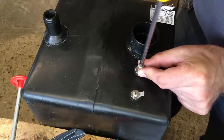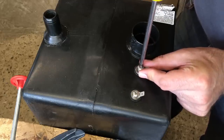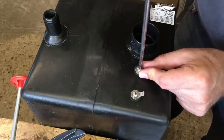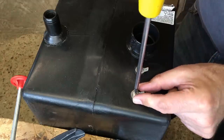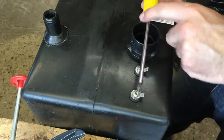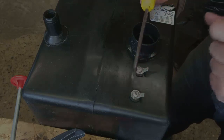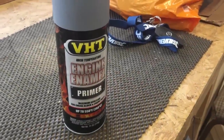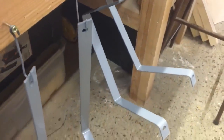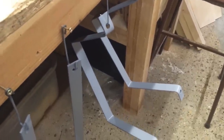On the level gauge we've got a couple of cables that will run down underneath the vehicle and join onto these with a couple of spade connectors, giving us a signal when the waste tank's full, which will come up on the little control panel inside the van. Once the water gets to the same level as roughly halfway on the inlet, these two will trigger and give us that signal. I'm just using a bit of grey engine enamel primer to put a coat on these brackets for the tanks that are going underneath the chassis.